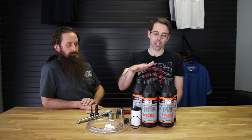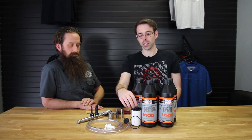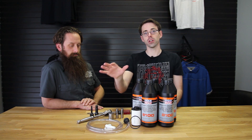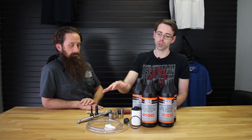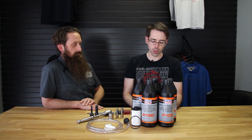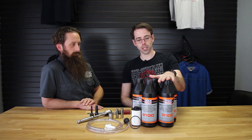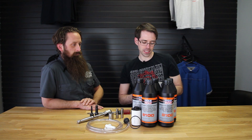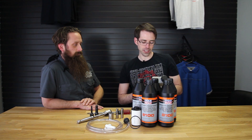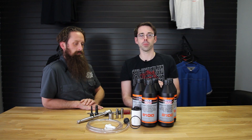Here we have our service kit, which includes five liters of fluid, a filter, a filter gasket, and some kits have the option of the drain or fill tool required for the DSG. The fluid must meet the same spec as the OEM fluid — spec TL52182 — found on the Liqui-Moly bottles. Any fluid you install in your DSG must have that spec, otherwise you can compromise the warranty on your transmission.